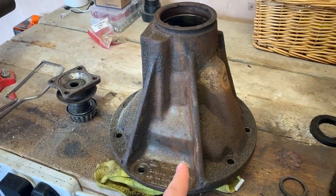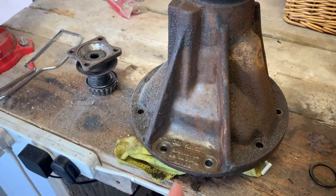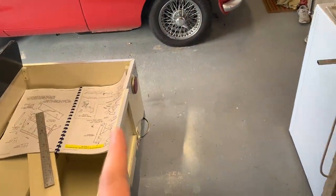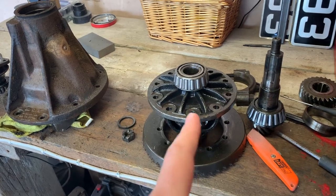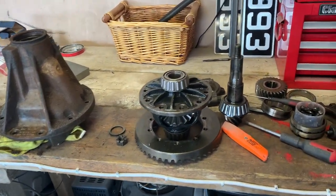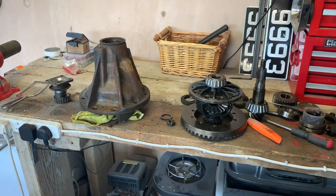The main housing is probably the biggest job. I took a bit of a wire brush to it just to see what the quality was like underneath and it doesn't seem to be too bad. There's a lot of aluminium shavings around from where I've been cutting for the Toylander. I've decided I'm probably going to scrap all the bearings - I thought I was maybe going to keep two because they're fairly new, but what's the point? If you're going into it that far, just do the whole lot. So I'm going to get some degreaser, get a container, and get some cleaning done.